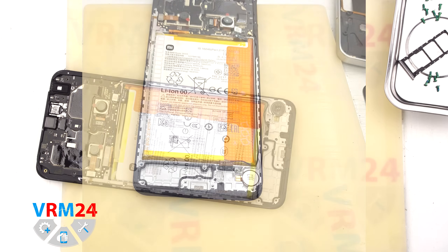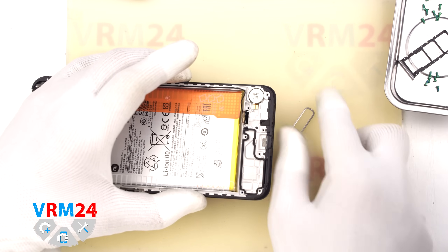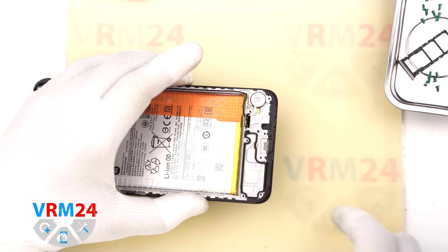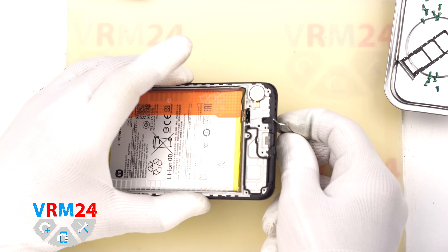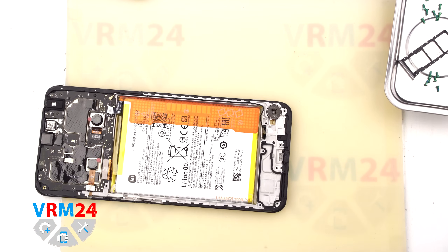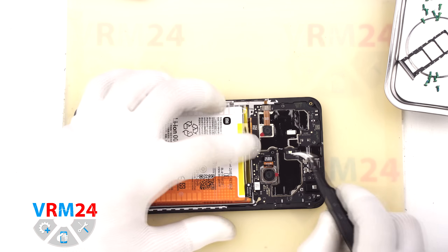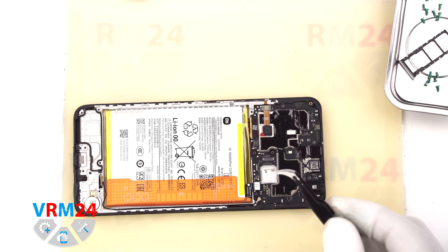The vibration motor remains in the display frame. Here is a quick note on the microphone opening: the microphone hole is in the display frame, has an L-shape, and is protected by a mesh or membrane. If you insert something into the microphone hole you won't damage the microphone itself, but you might damage the mesh.